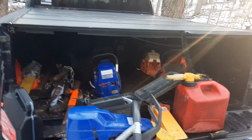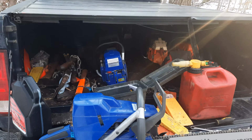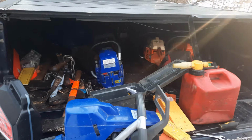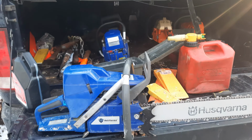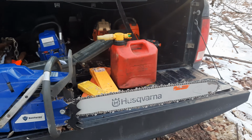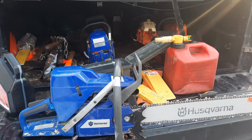With the 288, if I had a 24-inch bar, if the trees were a little bit smaller, I could probably go up to an 8-pin and get the chain speed back, and it might be a more efficient machine in that class of wood with that bar size, but not with a 28. So you've got to balance that. You've got to balance the trees you're cutting, how hard the trees are, the cutting characteristics, the chain, how you've got that ground, bar length, power, all that stuff.